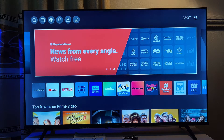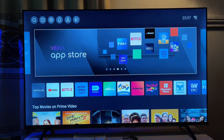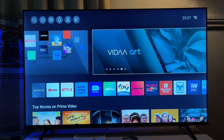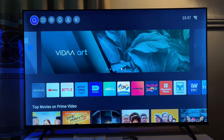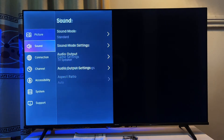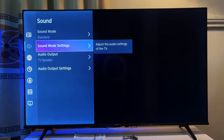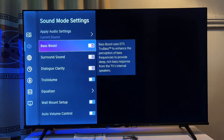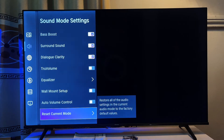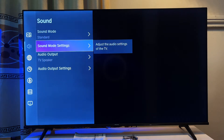If you've tried those steps and the audio or sound of your TV is still poor or does not work at all, another thing you want to do is reset the sound of your Smart TV. To do this, come to the top bar, go to Settings on the TV, then go to Sound, click on it, and go to Sound Mode Settings. Scroll down to where you get 'Reset Current Mode' — this automatically resets the sound back to default.